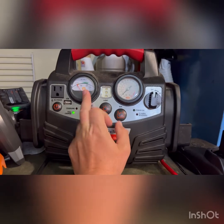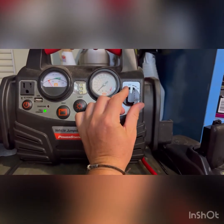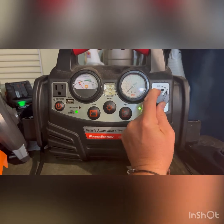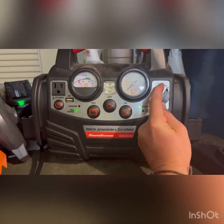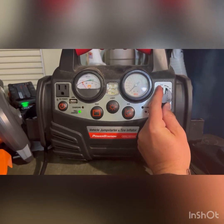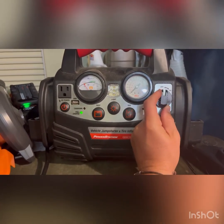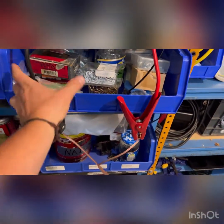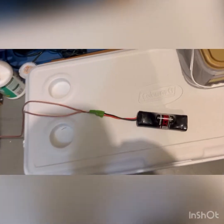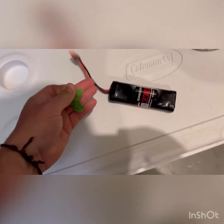It's not reading really right now — it's showing that it's dead. We're gonna hit this on and off intermittently to just give it a base charge. So we're gonna hit this and kind of feather it — on and then off — and we're gonna do that probably just a couple times to give it somewhat of a charge. After we're done, we're gonna disconnect our cables. Since this is off, we're not arcing anything. So we disconnect our power here, crudely connected as it is, and I'll show you what happens with the two chargers.